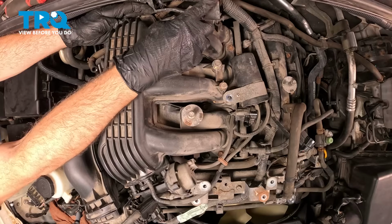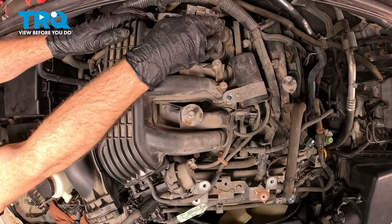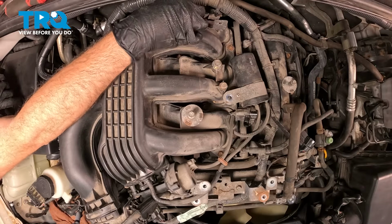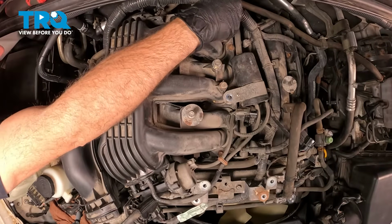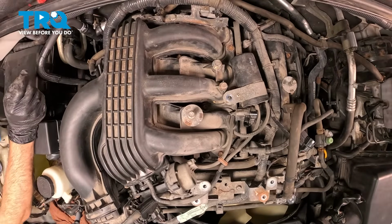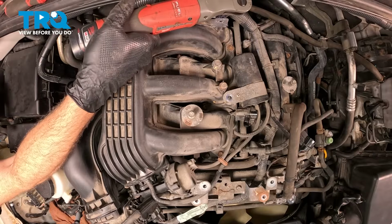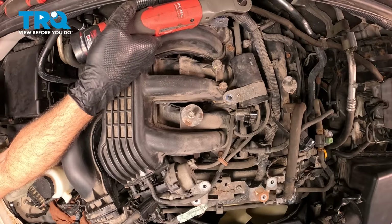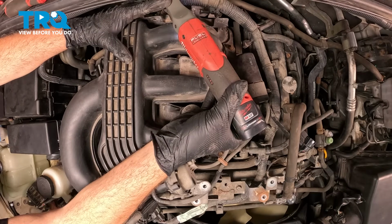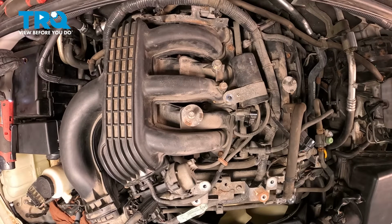And on the back of the intake, you want to go ahead and bring that bracket up. Get this positioned on the top here. We have our two 10mm bolts. Once we get those started, let's go ahead and snug those down. Once those bottom out, you're pretty good with that. You don't have to over tighten them because you're just tightening that bracket down to a plastic intake.